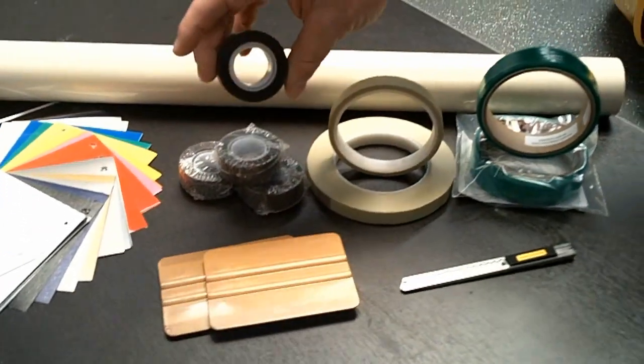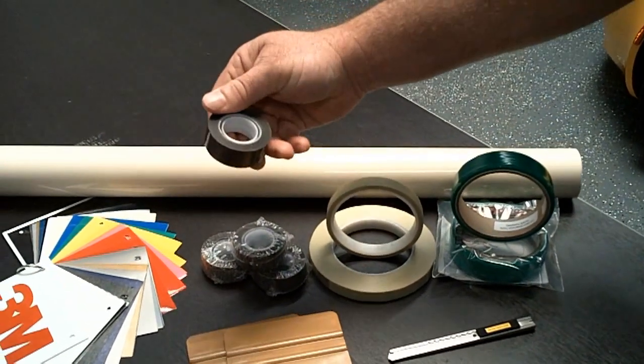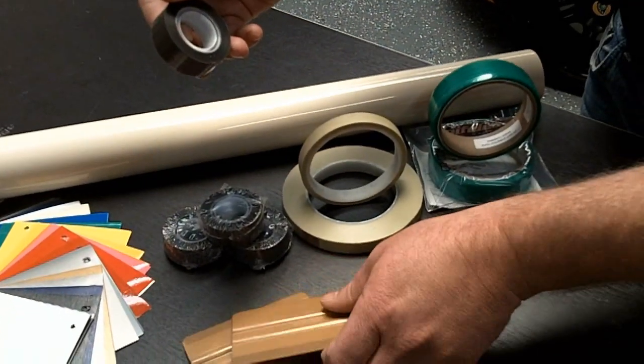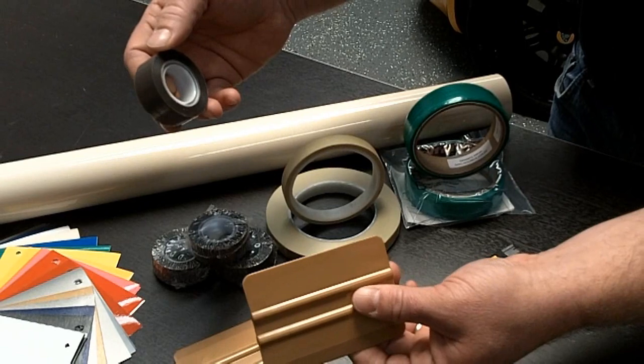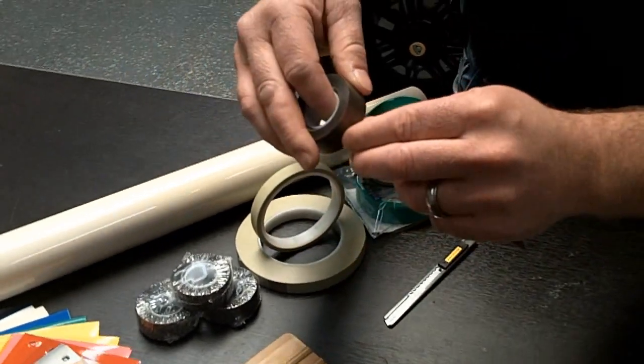First, we have our Teflon anti-friction tape that can be applied to your hard card before your installation. The Teflon will help minimize scratches on the film during installation. Be sure to change the tape out between jobs or multiple times throughout large vehicle wraps. Each roll is 36 feet long, so you can cover a good amount of squeegees.